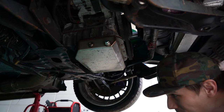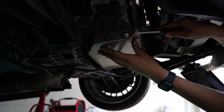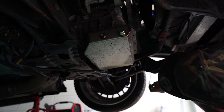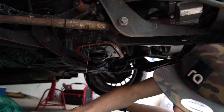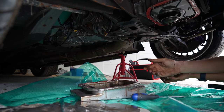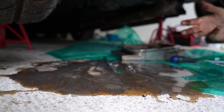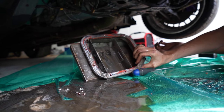We're now under the S15. I've gotten all the bolts undone for the oil pan so I'm going to pry this thing off. I think it's going to be hard judging by how much RTV is on here - it's probably really glued on. And then... oh my god, that just flew off! That's where all the moisture was. I made the biggest mess on the floor - thank god I put the plastic down, but it's still hit the concrete. Look how nasty that looks - that's all the water we've been trying to get out.